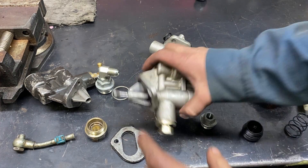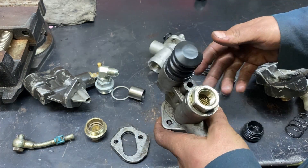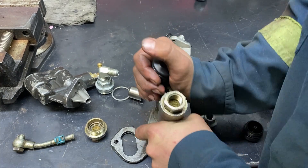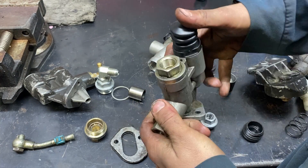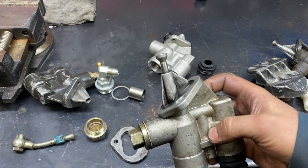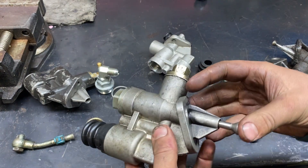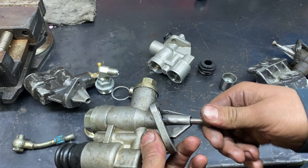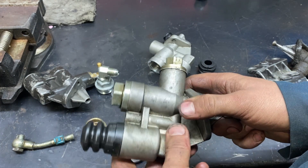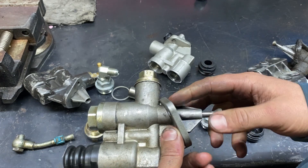After assembling your pump — or Frankensteining it from other parts — to test it, just push down. It should make that pig-snort noise again. Test the primer, make sure there's no metal shavings in it. Something to note: with the heavier spring, it is going to be harder to push the primer down, and putting it on the cam lobe is going to be a pain as well.